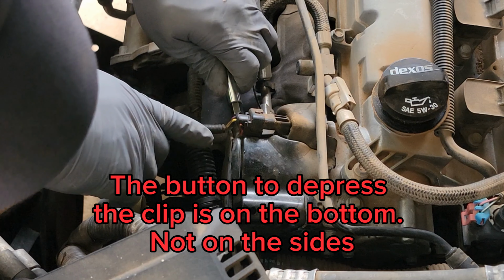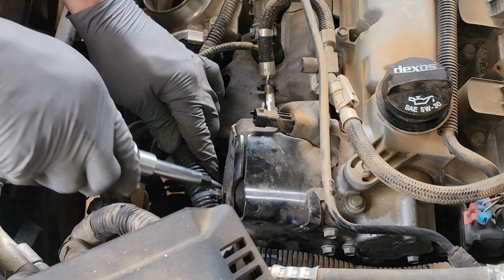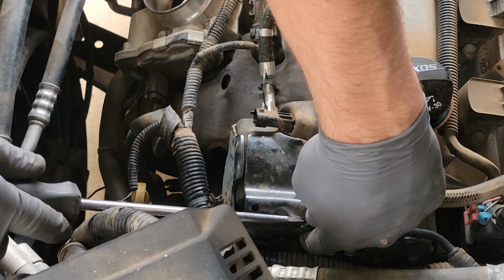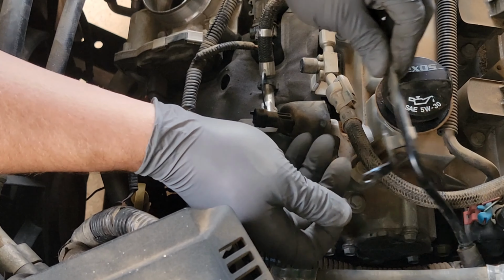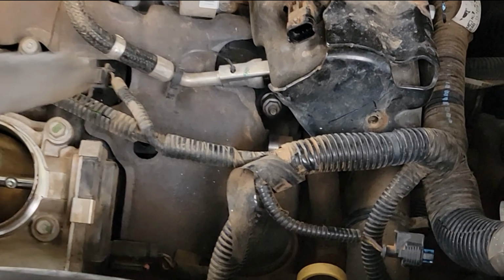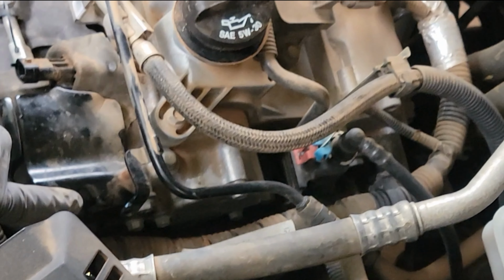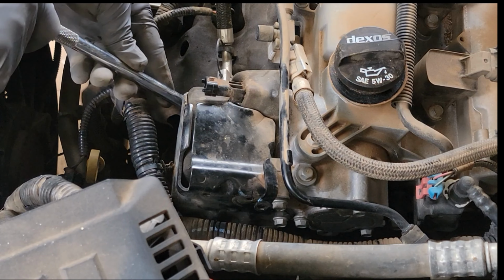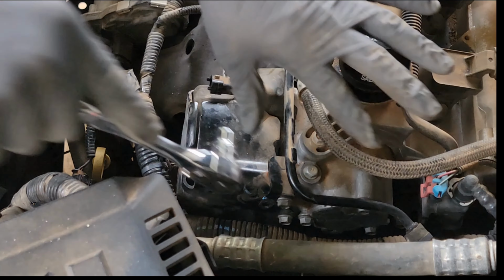Okay, I'm gonna unplug. Remove this wire loom clip. Remove that clip. Flathead will do. Pop that up. Pull this out so I don't lose it. Set that aside. That 10 millimeter bolt on the bottom side there, and two on the side. One right there. One right there. 10 millimeter nut on the bottom. Two on the side. Right here.